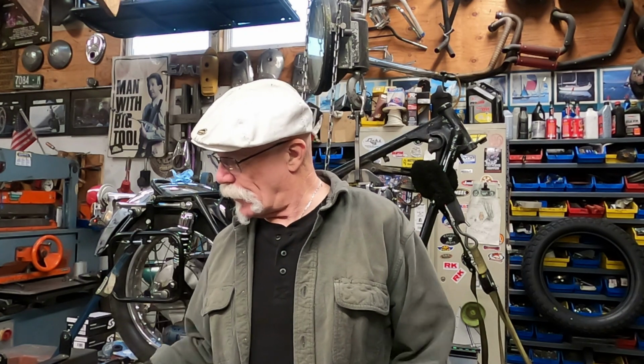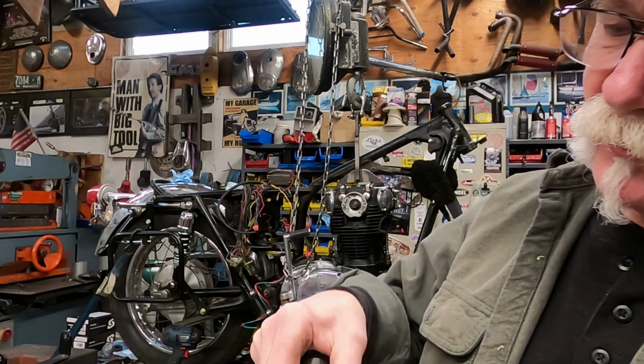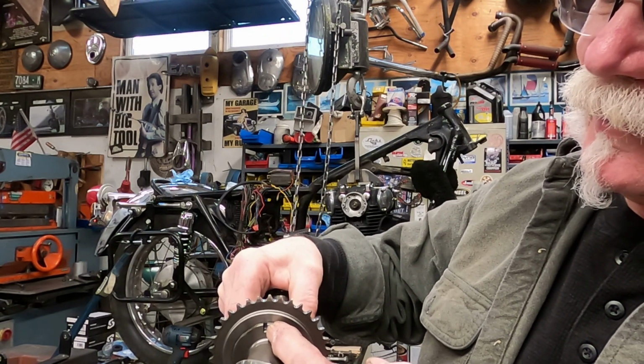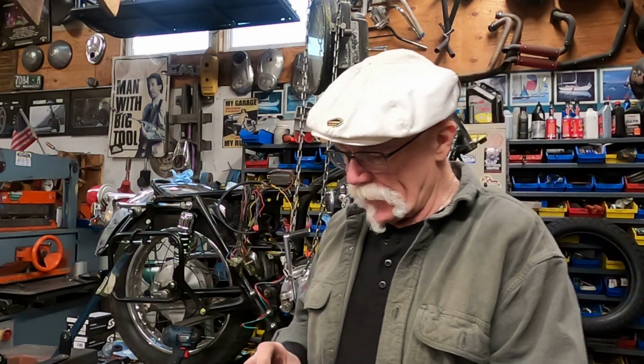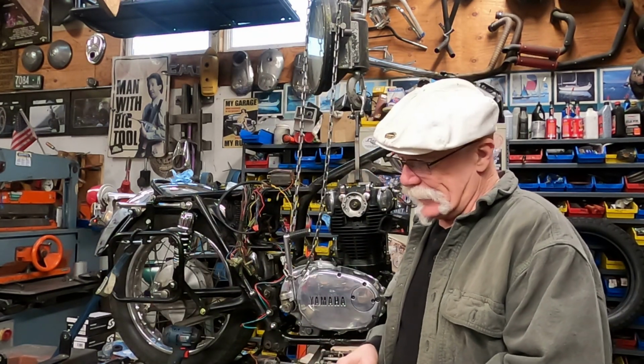Today I'm here because of John, one of my subscribers, who sent me a little comment. I screwed up on that video, parked episode 7, about lining up the cam. I really messed up on this one. I'll show you here. This little notch that is supposed to be straight up and down at 90, I had it offset 90 degrees. John caught it, and I've got to thank John for this, because I just put that motor in this bike, and I probably would have had a heck of a time starting it up.